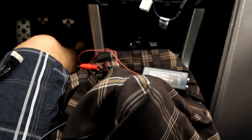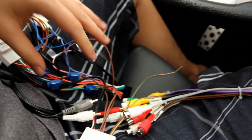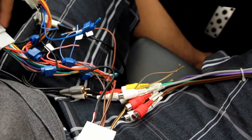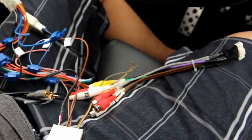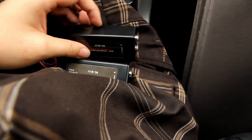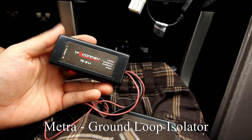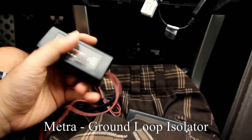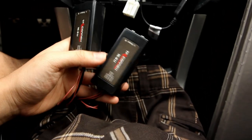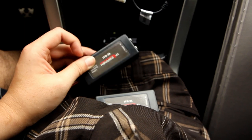There is some humming noise coming through. I tried grounding and other solutions — I'm not an audio installer by any means. I used crimp wires because I want it to be reversible, which could also cause the hum. These are ground loop isolators — these remove the hum for me. I bought them at Best Buy for about $10-12 each, bought two of them, and they reduce the noise by about 90%, which is a big difference.